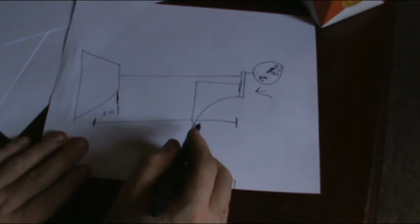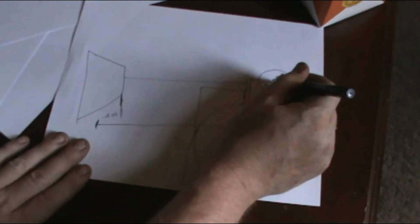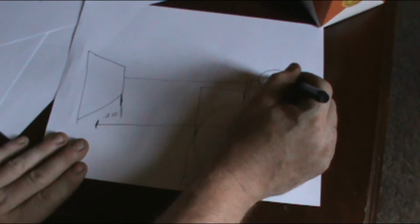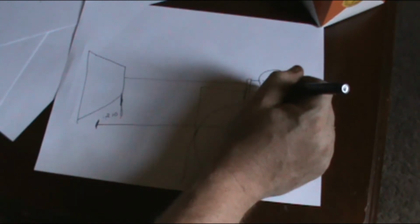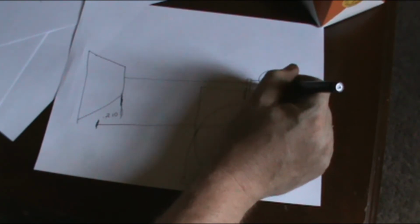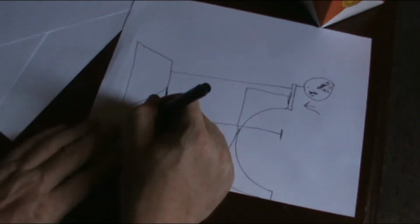I know I confused it up here a little bit, but let's just say it's pointing at the 10 and the 2. Because if it was pointing at the 2 and it was pointing at the 90, I would assume that it hadn't gone the full way around to 0, and those two numbers should be flip-flopped. But you get what I mean. If it's past the 2 and it's between the 2 and the 3, like you read a clock, and it's pointing at the 10, it's 210. So this distance is 210 thousandths.